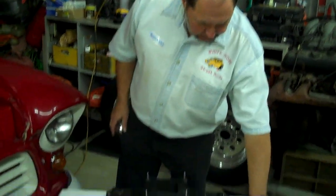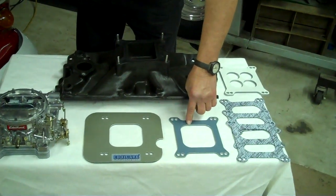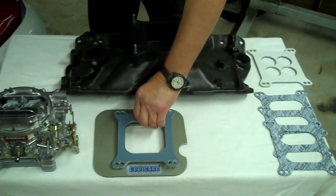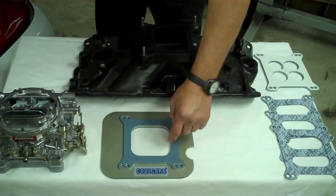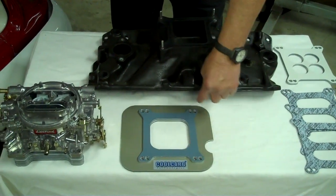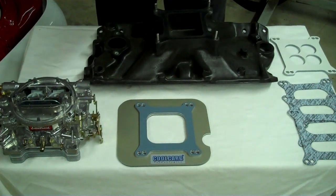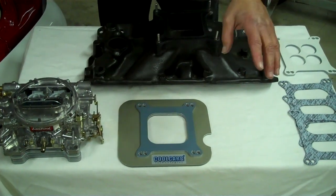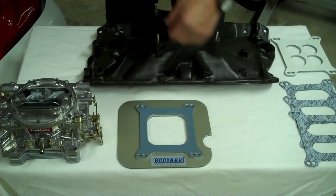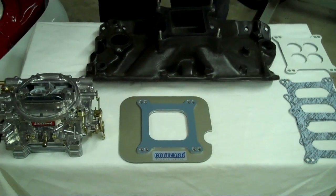What we've got — you're going to need gaskets if you're going to be using the gasket size plate and the shield. Most guys are putting the plate and the shield together because you do get double the thickness of the insulated value and you can wind up with an air gap. Air does not conduct heat or cold, so that's why they put them in insulated windows and in the boating industry. This actually gives you a triple insulated shield when you do it this way.